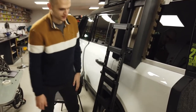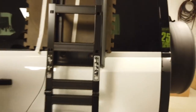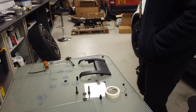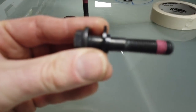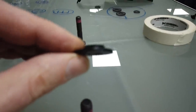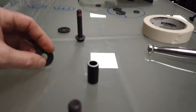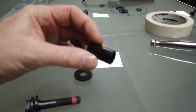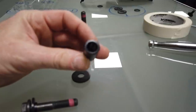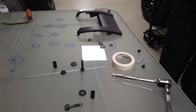Do our holes line up, Tyler? Yeah, there's some sort of line-upage going on there. Now we've got to insert from the outside - a bolt with the little top hat. So the top hat goes on that way onto there - that's a plastic top hat washer. Then with cunning and dexterity, Tyler is going to put that through the ladder, then the flat washer, then the spacer, which is going to push against - that should go through our 19mm hole. So Tyler, you want to grab those bits and see if you can get one of those in?